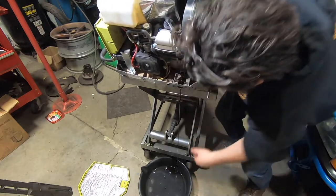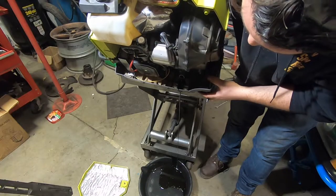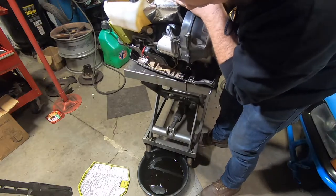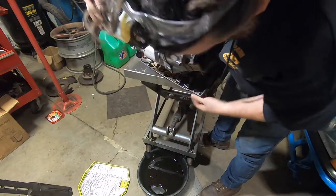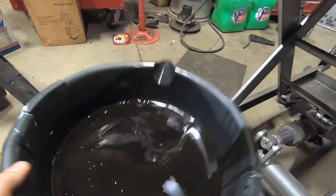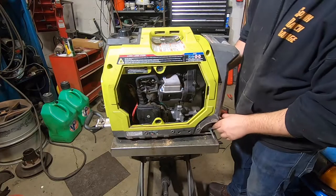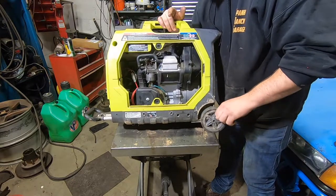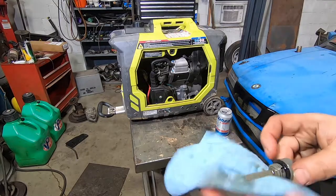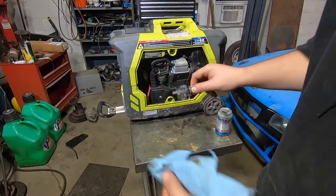A little bit on the floor — that's what's up. Hopefully you don't spill anything, but with the way the design is, the further you tilt it the more oil you get out, and then where do you draw the line? Don't be alarmed if you get hardly any oil out of these. I might have a quarter of a quart here, but it was full, so maybe that's all these little motors hold. Just put fresh oil in it. One thing to remember: do not thread the dipstick in when you're checking the oil on these. You're full, you're clean, everybody's happy.